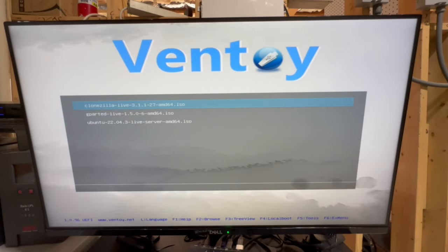Alrighty, guys. So all I did is I turned the machine back on. I let it go through the boot sequence and it naturally booted into Ventoy, which we have installed on our USB stick from earlier. And then as you can see, we can go to clonezilla if we need to clone a drive. We can go to gparted if we needed to adjust some drives or partitions or whatever the case. And then we also have Ubuntu 2204, which we can use to load onto our machine. So that's what we're gonna do now.